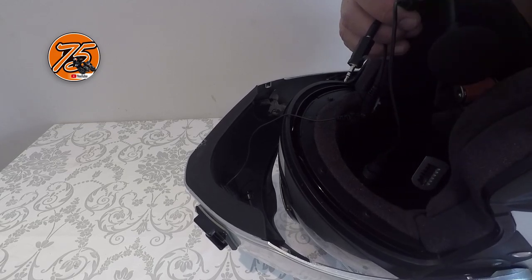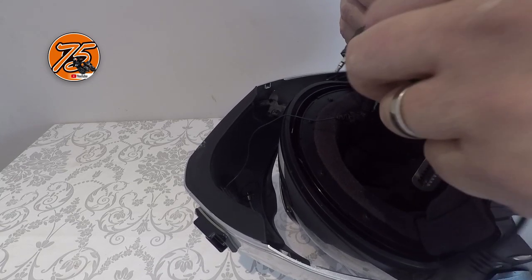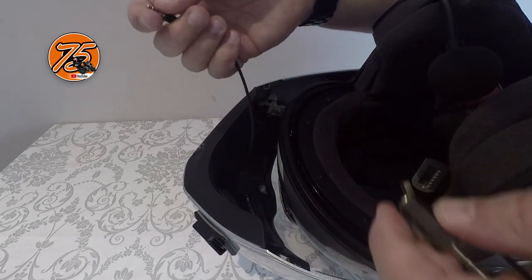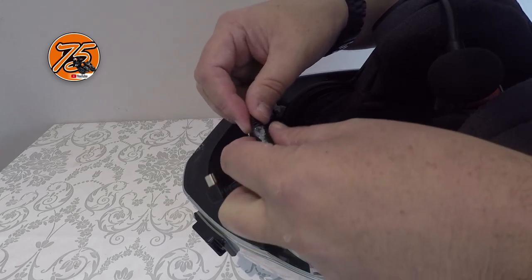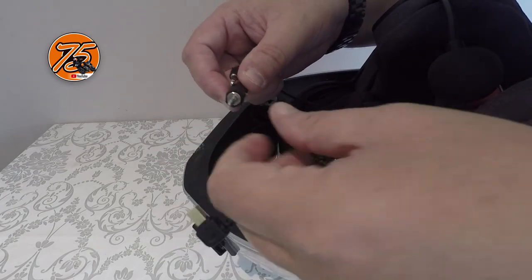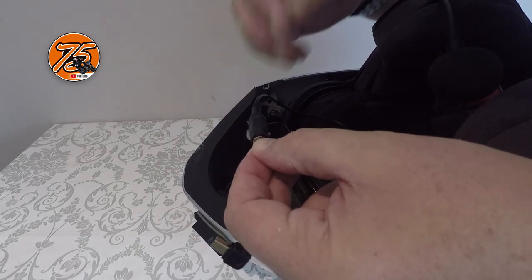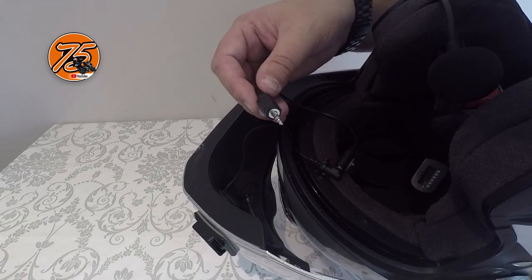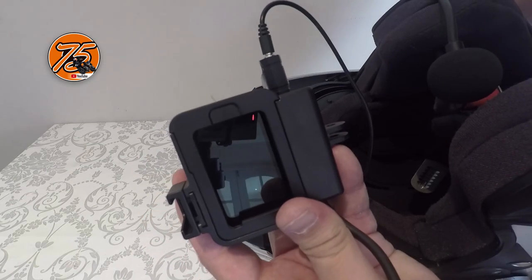However, once I installed it and put the video into my computer, I realized it's actually a mono microphone which means the sound is left channel only. It's also got a two and a half mil plug, so I need to put that into a three and a half mil adapter — two and a half mil female into a three and a half mil male. Then for two pounds I've got a mono-to-stereo adapter that converts the left channel sound into left and right, which makes editing through your program much easier.